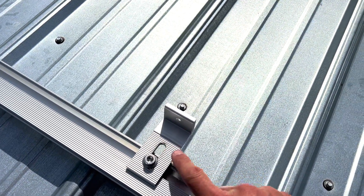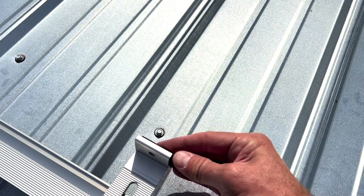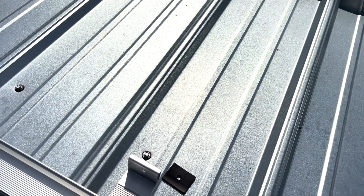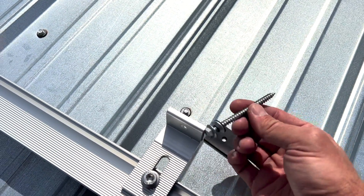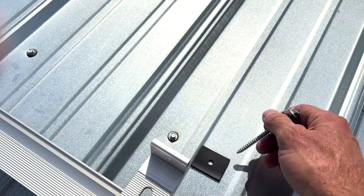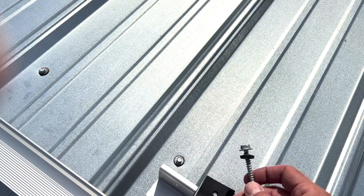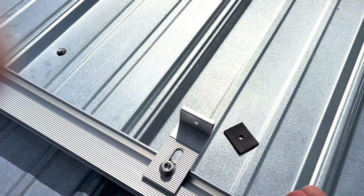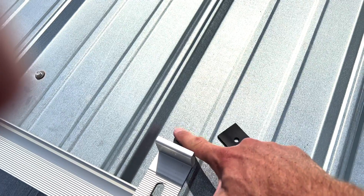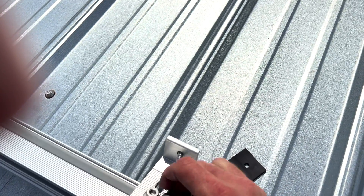My next step is going to be screwing in the railing. I'm going to remove one of the existing screws in the roof, put one of these feet between the foot and the hole so that it lines up, then drive one of those big roofing screws down into there. They provide fatter, longer screws so it'll go right through. If we can hit a stud on the other side, even better — all these screws should be going into the roofing slats, the one-bys that run across width-wise. Once I pull the old screw out, I'm also going to squirt some roofing sealant in and around the hole, and when I stand the rail up and put this in, it'll seal it all up.